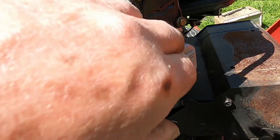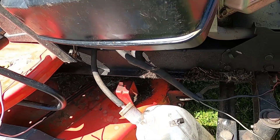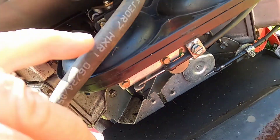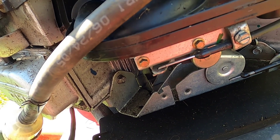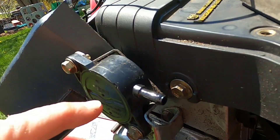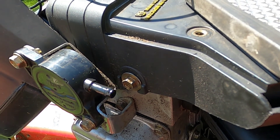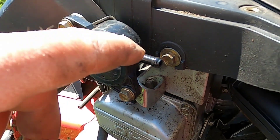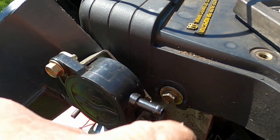I still think it's this pump because it's not pumping the gas. It didn't work with the gravity feed, so I'm going to be pulling this carburetor off to see what's going on. While this was disconnected it was spinning out some of the gas that was in there, so some gas did get in there from this tank. I'm going to connect the tank back to this and see what kind of flow we get out of here.